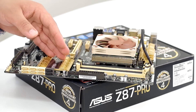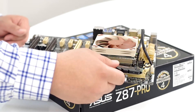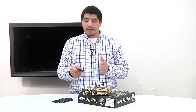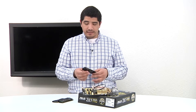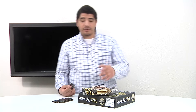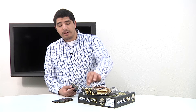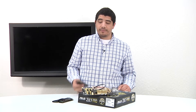If you take a look at the motherboard itself, the motherboard also has corresponding notching. So if you go ahead and essentially line it up, you'll be able to verify and see that the notching aligns with the DRAM. This allows you to make sure that you don't put the memory in backwards — if you do, when you attempt to fully depress and push in on the retention clip, it won't fully rest in place. So just make sure to double check those two items.